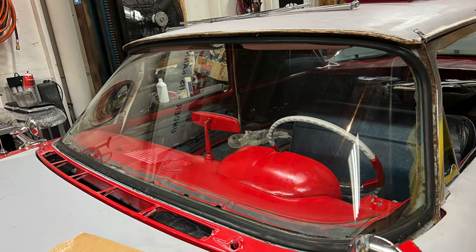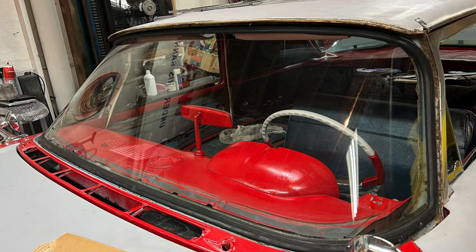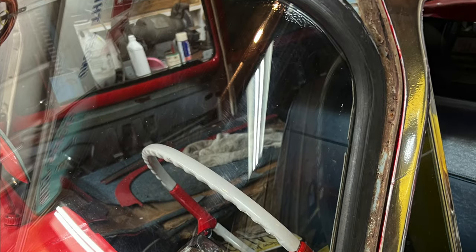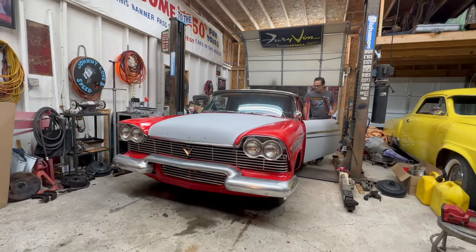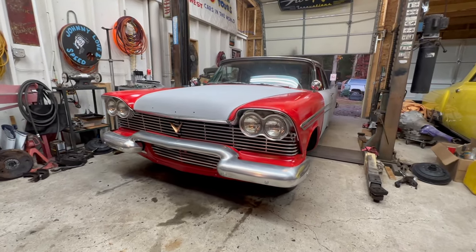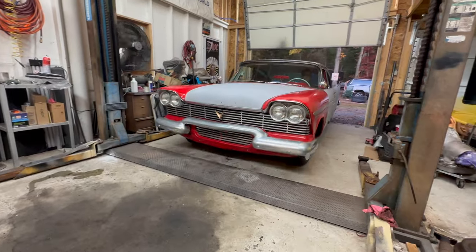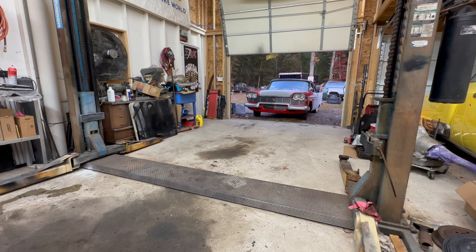In this video, since it was only for transport purposes and the windshield is going to be taken back out for a proper restoration, the gasket was put in dry on both the body channel side and glass side for a permanent installation after properly preparing the body by painting, epoxying, etc. The body side of the gasket, I usually take 1/4-inch butyl ribbon which is used to set glass in newer cars, stretch it slightly thinner to be the width of the gap of the metal side or body side of the windshield gasket or rear glass gasket.